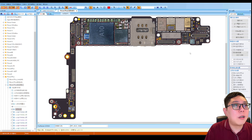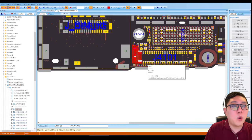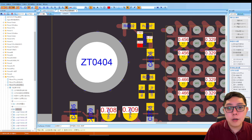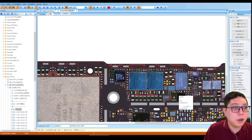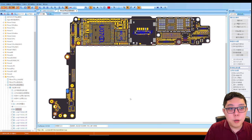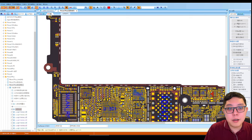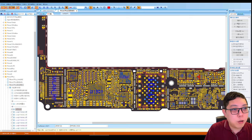Let's take a look at this iPhone 7 Plus. The charger port is here — USB power at 5V enters from here. Then there's a small MOSFET IC, the USB MOSFET. You have another line that is also 5V back to the TriStar. I don't call the TriStar a charging IC, because the actual charging work is done by the Tigris IC. The TriStar's job is to verify whether the accessory is original and certified, and to power up the accessory. With other smartphones, the USB power usually goes directly to the power IC, so if anything happens to the power IC, the phone becomes totally dead. iPhone has an extra IC to do that work — so it's actually lucky your phone is still able to turn on. Even if your adapter blew out, it can still be repaired; just send it to a professional who will check how bad the damage is.